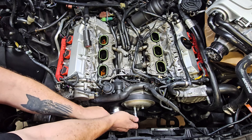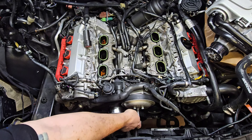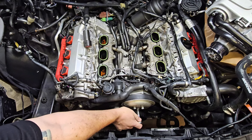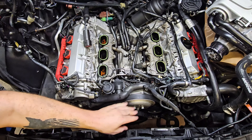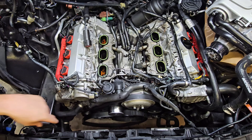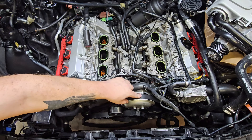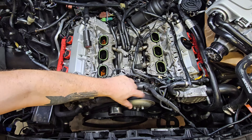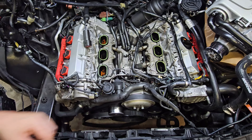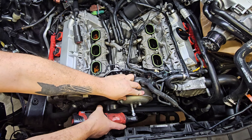After taking a look at things I do think it's going to be easier to remove the water pump pulley. With the belt still attached it's easy to crack the bolts loose — they're not on very tight. Get a 16mm socket and go down to the tensioner for the serpentine belt, loosen it up, and pull it off. If you're going to reuse the belt, mark the direction so you know how it goes back on. This pulley is held on by three M10 triple squares.